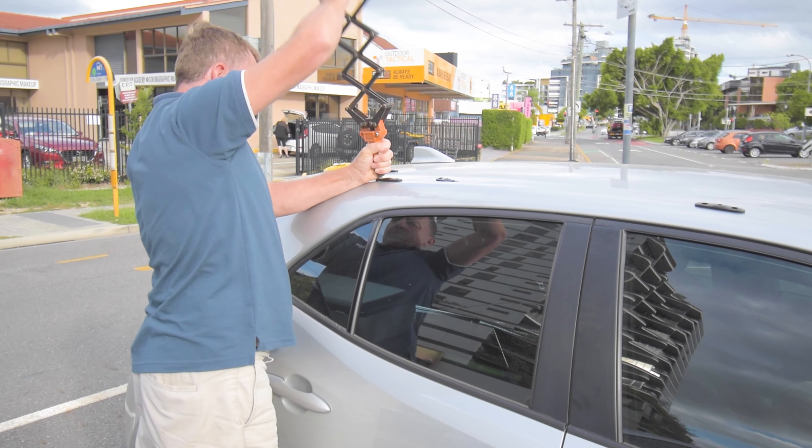For those wondering why we've decided to drill into our brand new car — we wanted to put a roof rack tent on top, and the wind turbulence underneath means a clamp-down mount isn't strong enough. If you get a really bad wind it could rip the roof racks right off with only a clamp mount. With these riveted in it's going to be a lot stronger, a lot safer, and we can put the rooftop tent on there with no worries.